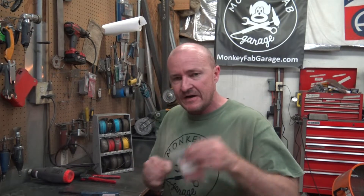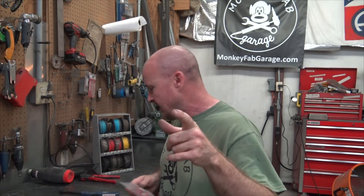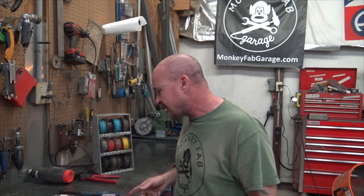You guys probably saw these on Facebook and every once in a while I get somebody saying those suck, but most people are pretty happy with them. I usually engage that person and ask what's the deal. They'll say I yanked on it and it just popped right off, which is always frustrating. For me, those plastic covered crimp connectors never stay together and I won't even use them. Before this I used to do the heat shrink and solder and slide it over — very time-consuming. These are pretty quick; I'm very happy with them.